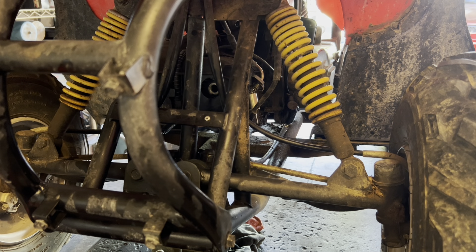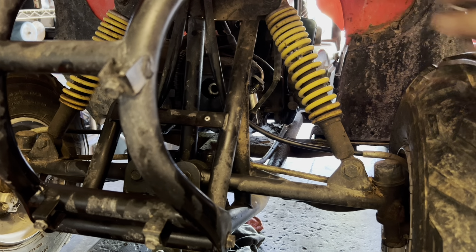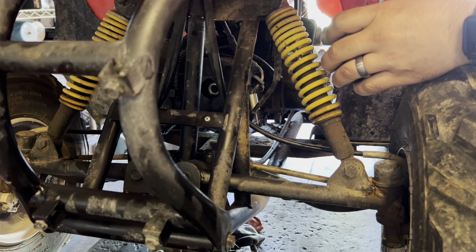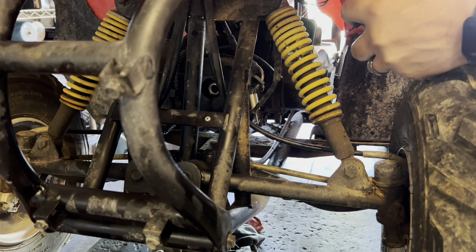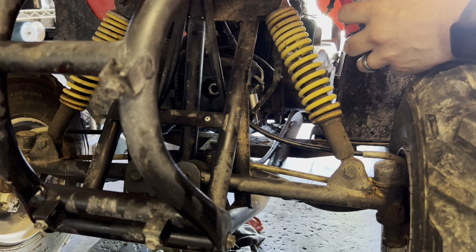Welcome back. Well, I know that's not the greatest vantage point, but this thing's pretty small and I don't believe there's enough room for both of us in here. I'm going to put a dab of nickel anti-seize in here where the choke assembly goes in, and the throttle barrel. We're going to put the choke assembly on first. Looking at the seal - the seal looks good. I think this is the choke assembly, could be wrong. Been wrong before.